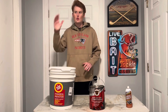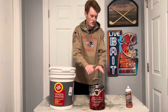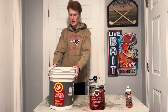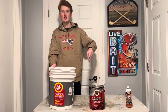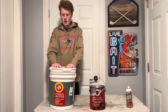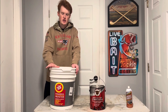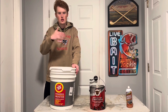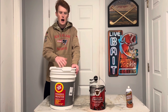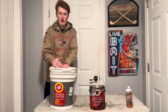Before we get into the actual frame undercoating, I want to talk quickly about how these products are different, then show how I set up the fluid film in the undercoating gun. When it comes to fluid film durability, I would only push this for one complete year — October to October of next year. But once that next year rolls around, you just recoat it. You can add layers to fluid film, and that only helps you.